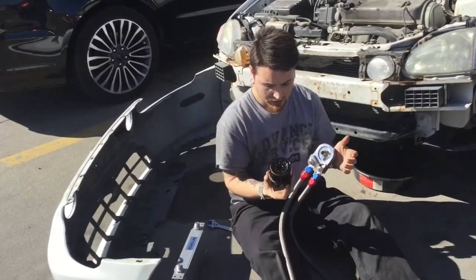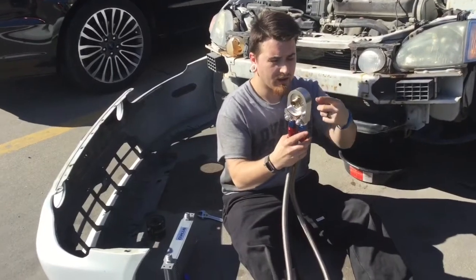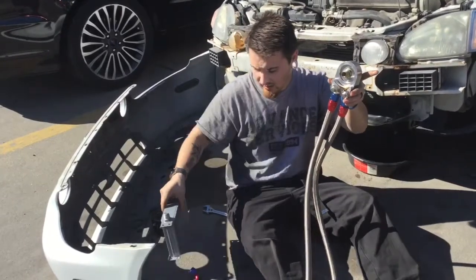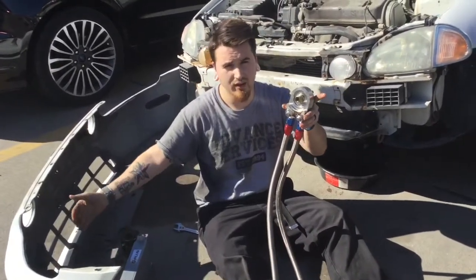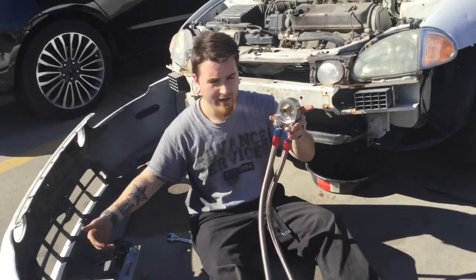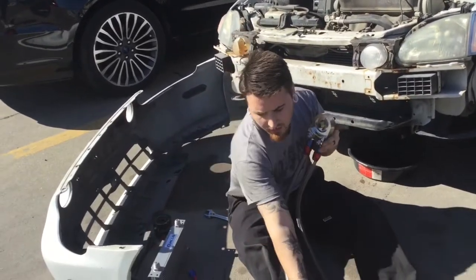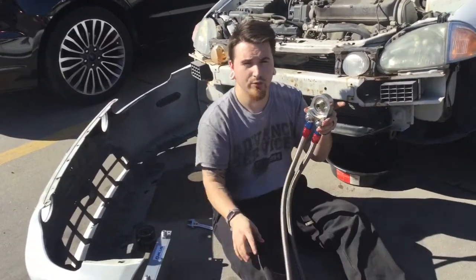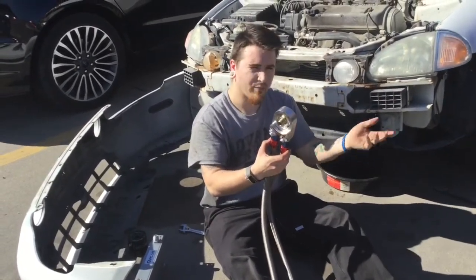So just like that. The whole point of this is that when the oil cycles through, the hot oil goes through this line and feeds into the oil cooler. You can mount it wherever you want — I like to mount it on the front bumper so when you're driving, wind goes through the oil cooler, cooling down the oil, then it feeds back through the oil filter.